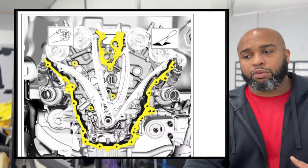We're going to go cross-section with it. 1, 2, 3, 4, 5, 6, 7, 8, 9, 10, 11, 12, 13, 14, 15, 16, 17, 18, 19, 20, 21, 22, 23, 24. And these bolts go down in a two-stage pattern. They're going to go down to 177 inch pounds. And then after that, we're going to go 45 degrees, which is at midnight, and we're going over to 130. So 12 to 130.